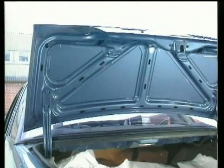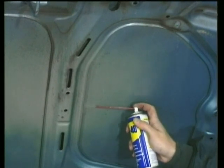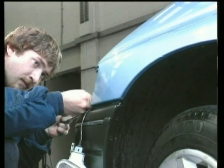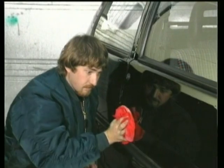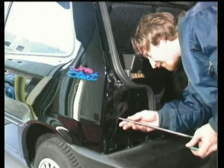Some areas that you will work on will remain on view after the repair is finished, such as the inside of a boot lid. To prevent damage, tape the end of the rod or hand tool with suitable tape and spray the surface with light oil — but be aware the surface is now more slippy, so be extra careful. We have now shown you the skills needed to remove dents with our system. There is no quick way to learn — you must be prepared to put in a lot of time and effort, and ensure that you practice, practice, and give it more practice.